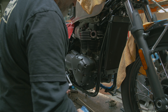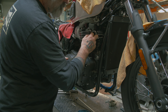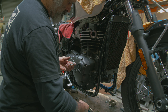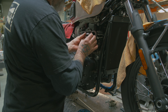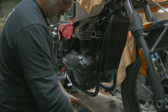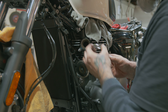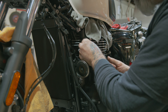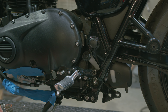Now we can fit our exhaust gaskets. These aren't a tight fit in here, so you need something to hold them in there. You could just put two little dabs of grease on them — you don't want to put a bunch of grease or it'll be smoking forever, just one little bit. It'll burn off as soon as you fire the bike up, and it just keeps it in place. Do the same thing on the other side — two little dabs of grease. Actually, just clean this out first. Now we need to remove this bolt here and put our kickstand down.